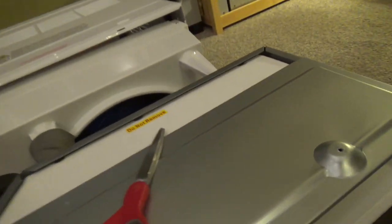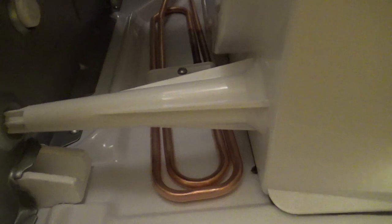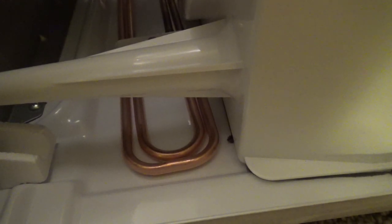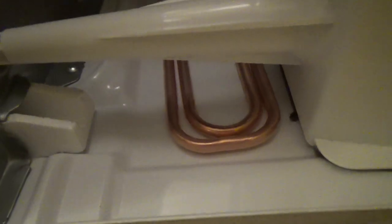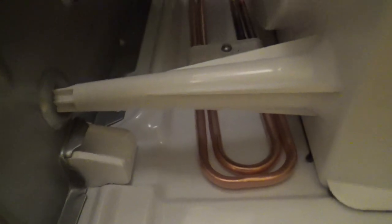Let's see what the drainage situation is. It has the stupid slinger wheel on the fan, plus it looks like it has a bunch of quill pieces that go along the bottom that are supposed to sit in the water. But I think this is dumb because it's just going to fill up — the water's just going to get hot. So I think what I'll do is put some hot glue to block this off and drill a hole so the water goes out and not into the condenser area. We don't want any water in there.